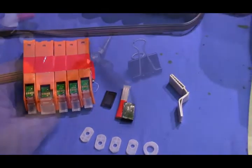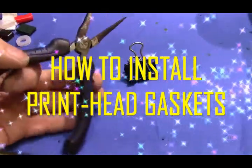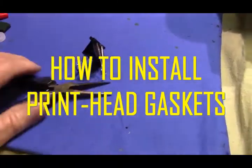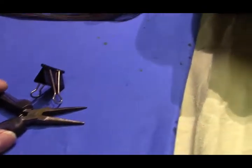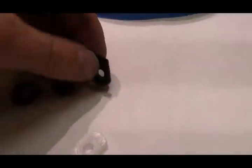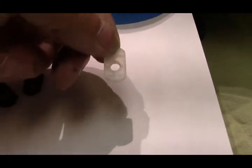Should you run out of ink, some things you need to supply are a pair of needle nose pliers and one of these large black paper clips. Now go over here, lift up and go in to see the printer. It's kind of dark in there so I'm going to put a light on. You can see I've already started to put the gaskets in. Here's what the Canon gaskets look like - little black ones - and we're going to give you a clear type of guard gasket for CIS cartridges, that's why you have to replace them.